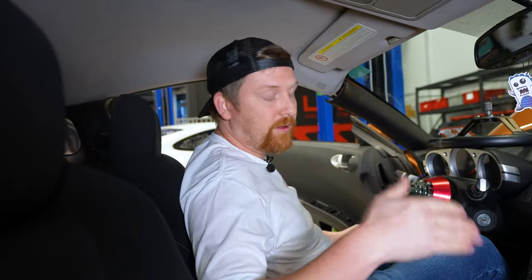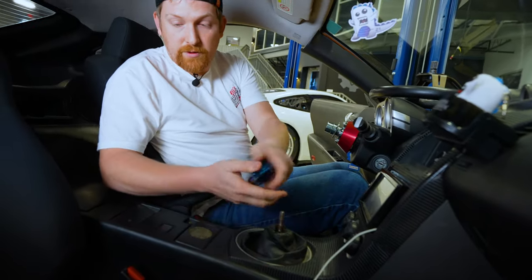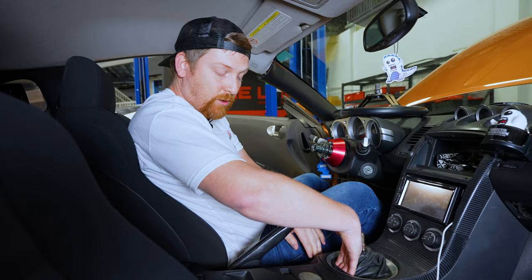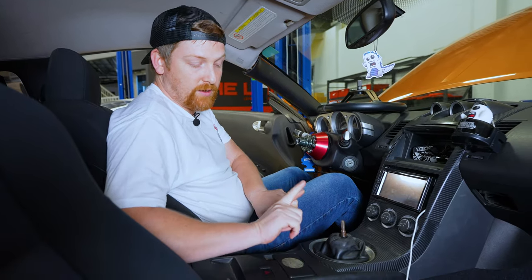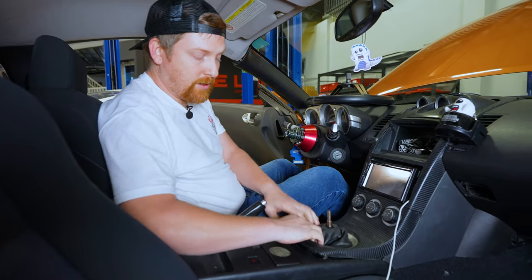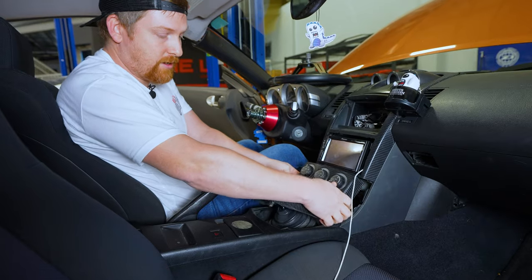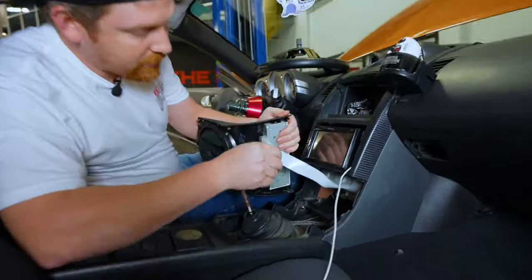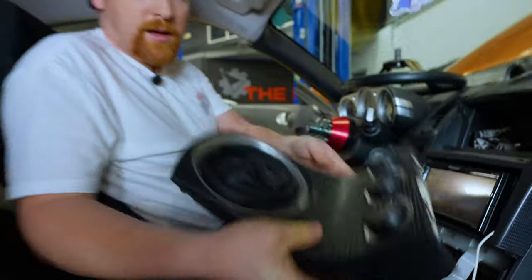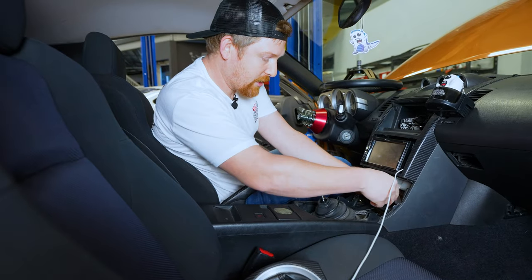So before we get the car off the ground, first thing is we're gonna disconnect the shifter. So start shifter removing, and then you're gonna put your hand right here on the back of the boot, and you can kind of put your hand in and hold it like a ledge, and you're gonna pull this center console trim piece vertical. And you can kind of put your palm here and just pop it up just like that. Two more there. And then you just kind of wiggle it, pull it up. Pull the shifter down into fourth gear, and it gives you a little bit more room to pull that up. And then you just disconnect the ribbon for your HVAC controls. Just like that. Set it to the side, take this ribbon, kind of wrap it up, tuck it in the back. You don't want to catch that or ruin it.